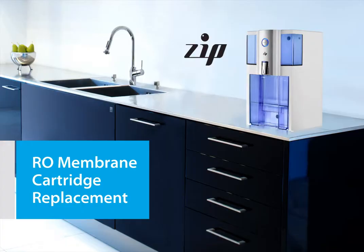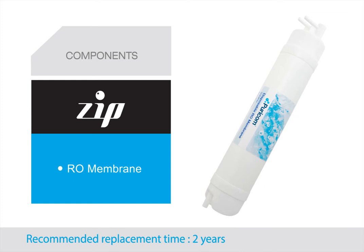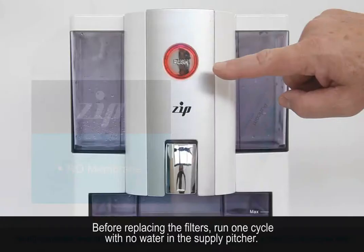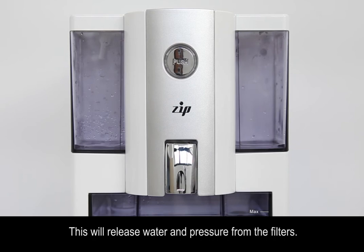RO membrane replacement. The RO membrane should be replaced at the same time you replace the post filter for the second time. Before replacing the filters, run one cycle with no water in the supply pitcher. This will release water and pressure from the filters. When the light is steady yellow, you can replace the filters.